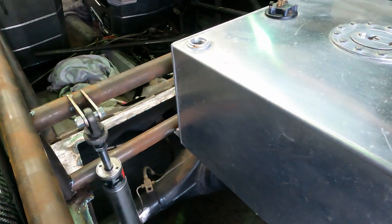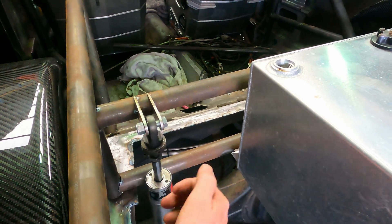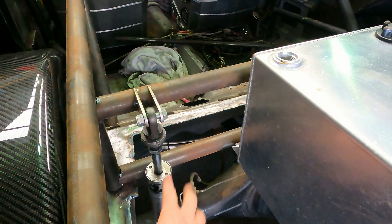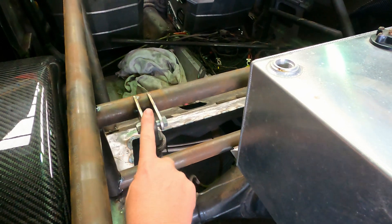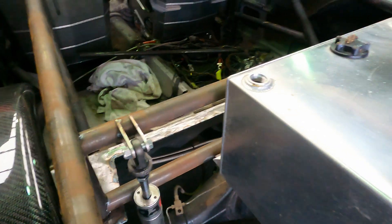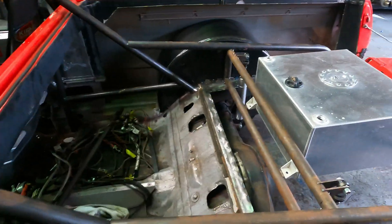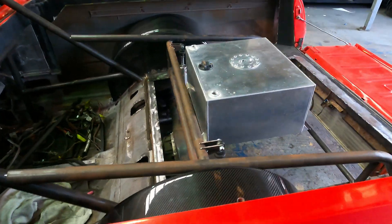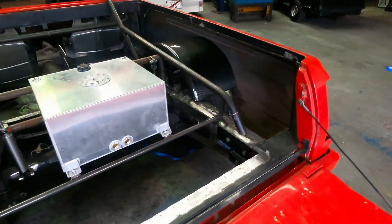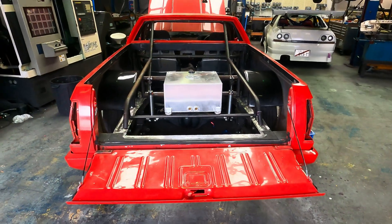Jump on the website, they're ready to go — you can buy them right now. The back here is what we were starting to go over: the shock. As we're going to explain this video, leaf springs separate on the hit and then all the way down the track. Having that mount really nice and tight and just letting the shock do its job is so important — that's the secret behind this back end of the chassis. That's why we're going to put a cage in — we did the back half too, it's not that much extra work and it looks rad.